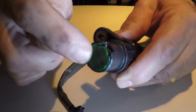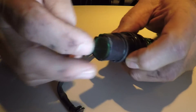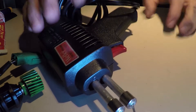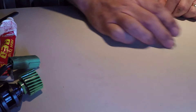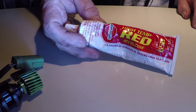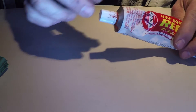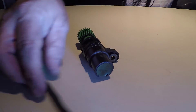What I'm going to need to do is pull this green plastic potting stuff out of the sensor so I can get to whatever the wires attach to in there and re-solder everything. For this repair I'm going to need a soldering iron, solder, wire cutters and strippers, heat shrink, and some silicone sealant to fill in the potting area and seal it up again.